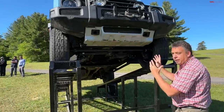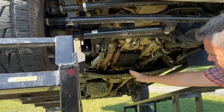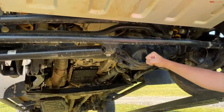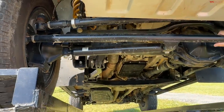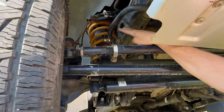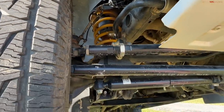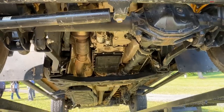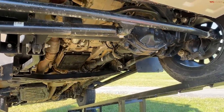If you look underneath here on the ramp, you can see the really beefy chassis — frame rails that run all the way from the front to the back. It's got solid axles front and rear. Look at the size of these components: huge steering components, huge anti-sway bars, a multi-link system. Inside you have Eibach springs and Bilstein shocks, but no airbags, no hydraulic suspension — nothing really complicated, just really traditional off-road capability.